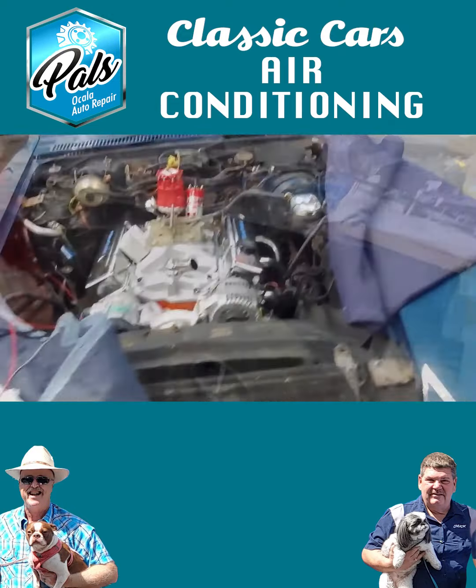Well, what we've done in both of these vehicles is gone through and inspected the air conditioning system to make sure it was functional. On the Torino, we actually had to fabricate new lines because the lines were in bad shape. But we convert it using a conversion kit, and it will work with 134A, just like a car that you got two weeks ago or ten years ago.